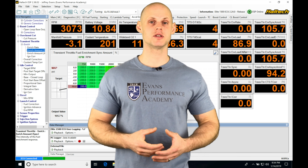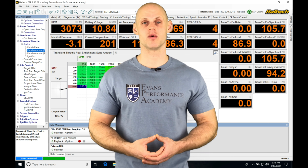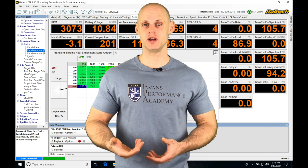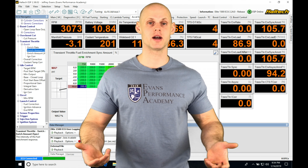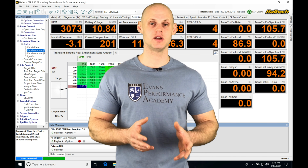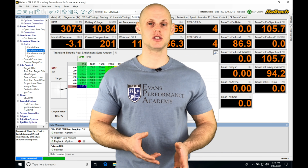All right, so let's jump into this video and talk about working with our nitrous control and our Haltech ESP software. So if we want to spray nitrous, we need to go in and pull some ignition timing and add fuel if we're on a dry kit. If we're on a wet kit, then we definitely need to pull ignition timing. So Haltech has a pretty awesome strategy for nitrous control.